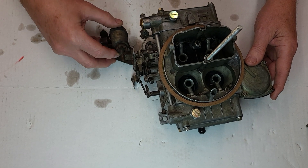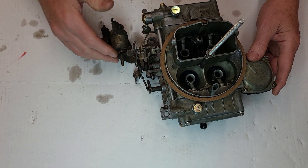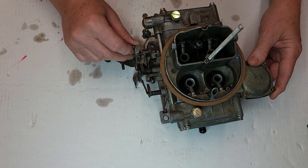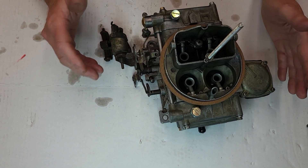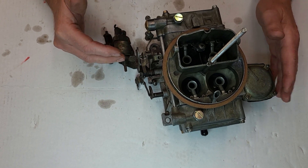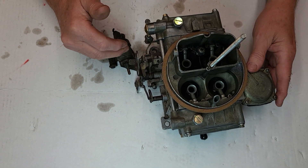This is just a quick video, but look at all of these when you're shopping — there are electrical vacuum-operated ones, and there are ones with a dashpot where when you open the throttle, it'll slowly let the throttle close back down to idle speed to keep it from cutting off with a quick throttle touch. You know, you touch the throttle real quick and let off, and a lot of these old carburetors would cut off. The dashpot is built into some of them — both electrical ones and vacuum-operated ones.